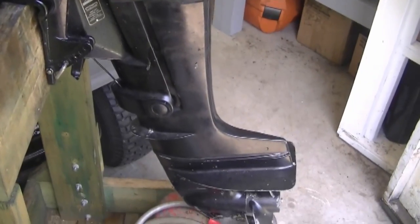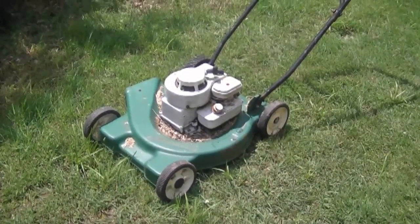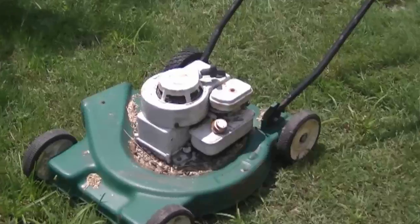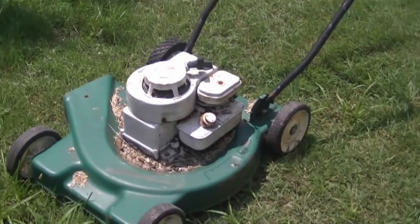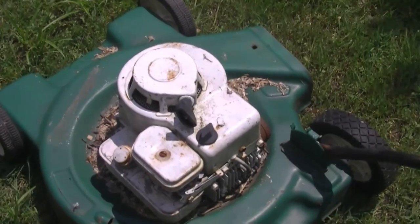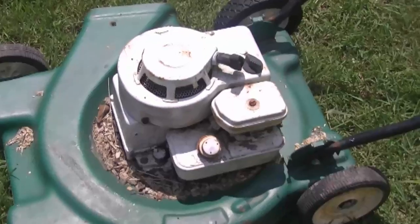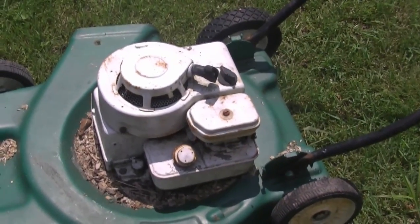The impeller is usually an inexpensive part — between 10 and 30 dollars. Now, someone has an old lawnmower with an older Briggs and Stratton engine and is wondering why it's burning a lot of oil. The cause is likely worn piston rings and valve guides, especially with an engine over 20 years old. At that point you may just want to buy another lawnmower. If it has sentimental value, you could replace the piston rings. You could also try an SAE 30 oil, which is a thicker oil for summertime, and that may help reduce oil burning.